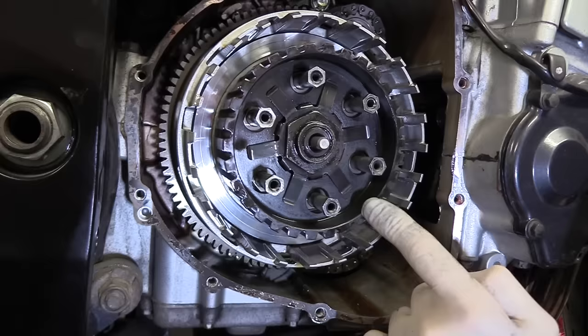I've got dowels luckily, because this is a 99 model. Let's just pop those in first. Right way up, there we go. That's it, there we are, all evenly torqued up, nothing too tight, nothing going to leak. Just put the sump plug in, fill it up with oil.